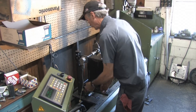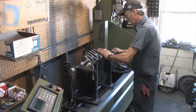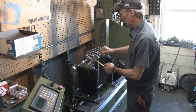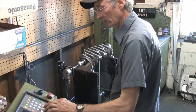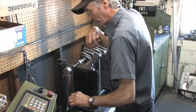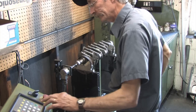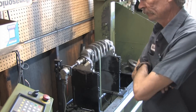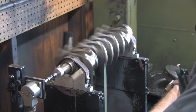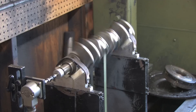This isn't a deal breaker to me. Because the crank is still within spec, I'm going to roll with it. The only possible deal breaker for me is if it were out of balance. When you balance a DSM crankshaft, you do not use or need bob weights — all the weight is already on a centerline. You zero balance the crank and separately weigh and match your rods, pistons, wrist pins, and all of the fasteners involved. If you can't mix and match wrist pins to balance them out, then you have to grind some material off to get all of their combined weights within a gram. There seems to be some misinformation floating around about these butcher crankshafts — some people with no experience think that removing the counterweights compromises its strength. The proof is in the pudding. This machine measures balance to within a hundredth of a gram. Let's see how well this butcher specs out after several years in a 600 wheel horsepower car and enough boost to stretch 12mm head studs.